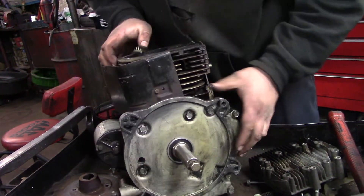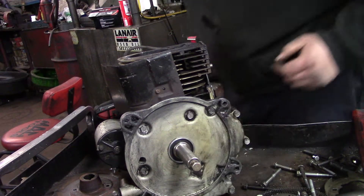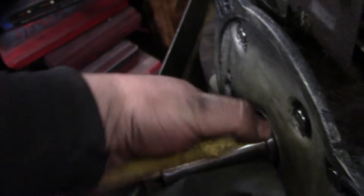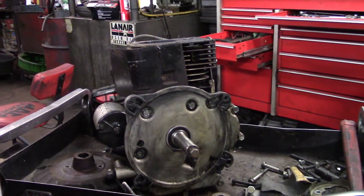I'm just going to pop the piston out of this. Right here — the crankshaft. This one's pretty clean. I'm going to take some sandpaper and sand this up — it actually looks pretty clean, I don't have to do much sanding. But sometimes it'll be rusted, and if you try to pull that off it'll score up your sump bearing. Due to that, the motor might not be any good — might need a new sump. Something to look into.